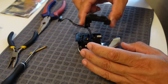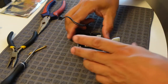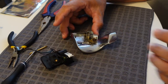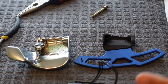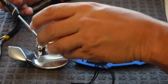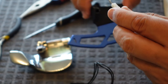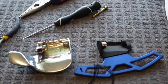Once that's out you can put in the new adapter for the type B installation. The adapter goes in there and the paddle shifters will be attached right there. I had to recreate this portion using the other paddle shifter because I forgot to hit record. This is the original white piece — it has a spring behind it, so be very careful when pulling it out. Then I take it into the new adapter which already has the paddle shifter attached.